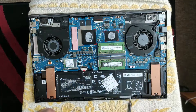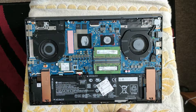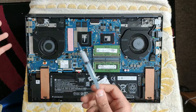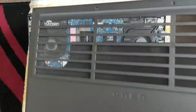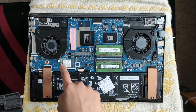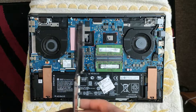What is not golden is the thermal paste, so I'll quickly repaste. I have two other videos on the channel about this so I won't focus on it here. One important thing: before you close it up, plug the battery back in — that's after the repaste. This tube lasts a long time; this is about the fourth repaste I'm doing and there's still a ton left. This time I'm making sure all the thermal pads are back in place — I'll check the lid too, because last time there was one on the lid for some reason. All of these are back in and that should be as good as you can get. Hopefully in a few months — hopefully a very long time — I'll have to worry about dust build-up again.